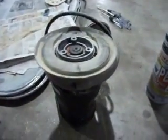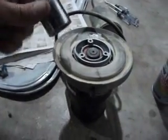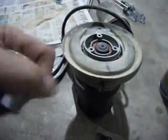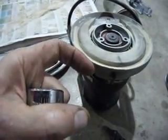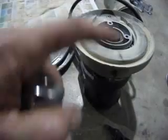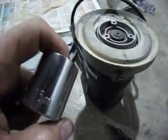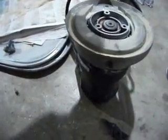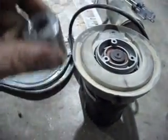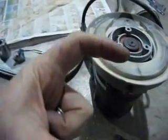Okay, I keep finding more and more things wrong with this, and one thing I left out a minute ago, I was talking about that snap ring. Sometimes you can get it kind of on the edge, but not totally into the groove. And a 25mm Craftsman socket, some of them are thicker than others around the edge, so I'm just saying it's Craftsman. And it's actually on the reverse side of this. I've already got it mounted, but I just tapped it with a hammer, boom, to make sure that the snap ring was into the groove.